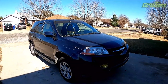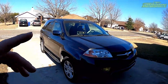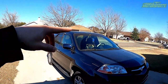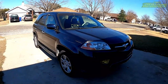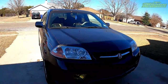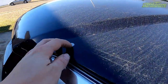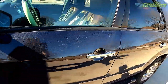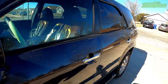No risk, no reward. So I'm going to go ahead and sand my wife's Acura MDX down with 180 grit, taping things up and taking things off. We've already taken the rails on the roof off and some other things, but we're going to take off more. We're going to sand this whole thing down. There's a lot of attention to detail we're going to have to pay here. Pay real close attention because this is chipped off. This is chipped off, so we have to very thoroughly sand. Right down here, you can see someone repainted in the past and it's chipped off.